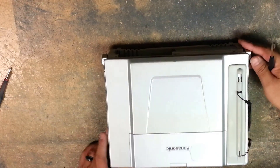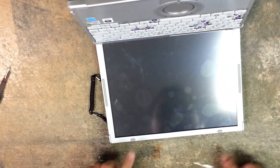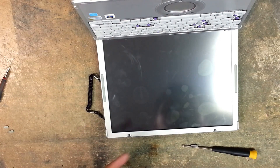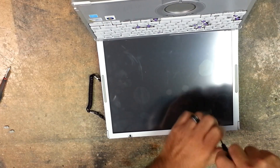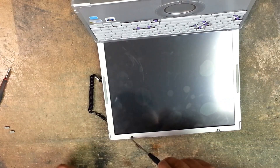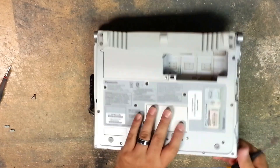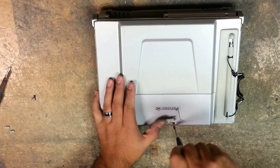So let's get to it. I like to remove the screws on the inside of the LCD bezel first — just remove the little bumper covers with the flathead, and that's all you need the flathead for. These will be tight on there; I've removed mine quite a few times so they're loose now, but they're pretty tight when you first get to it. We remove these two black screws — all these screws will only fit in one spot, so fairly easy to remember. Then I like to remove the ones under the cover here.